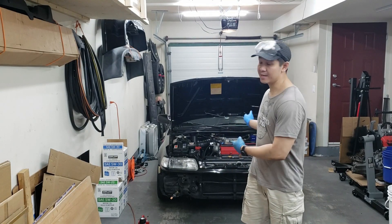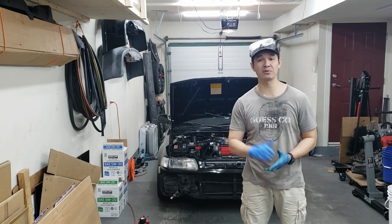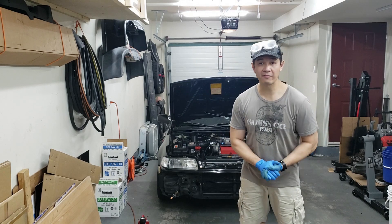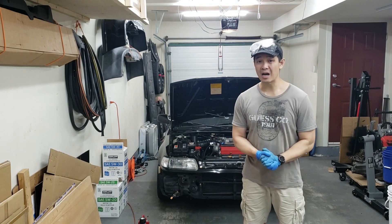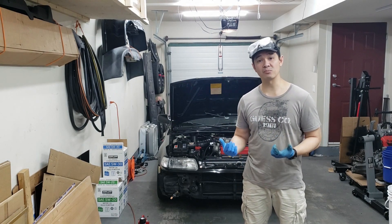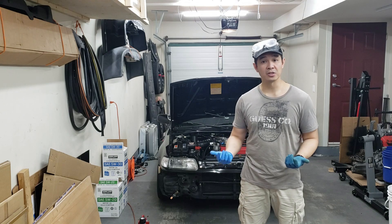It's official — we've got AC in the car. It gets down to about 10 degrees Celsius inside as per the thermometer, which feels nice and cold like every other car I've had with AC — I think that's a success. However, the AC compressor does make some noise when running. After filming this and driving the car around I noticed the noise only happens when the car is fully warmed up and at idle — if you add some throttle the noise goes away.